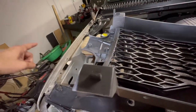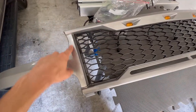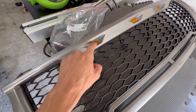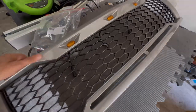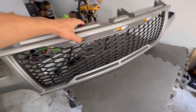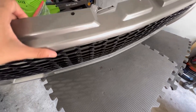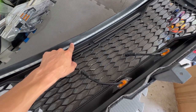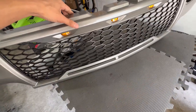The side pieces get screwed on from here — I had them off because I took them to get painted separately. They use about four screws around each side. I also put back the little amber reflectors with LEDs, which I think looks better. I might change them later but for now I like the amber color. I added LED strips on the bottom of the grill and along the lower edge. I'll hook these up to a headlight or parking light wire later so they light up white. The wiring is run and ready to tap into.